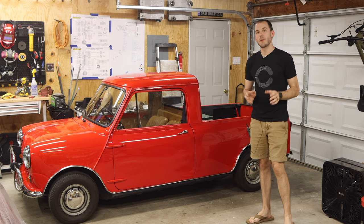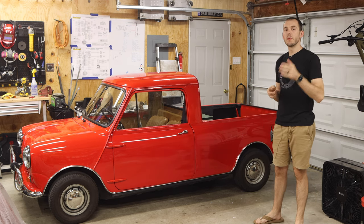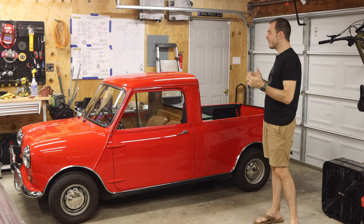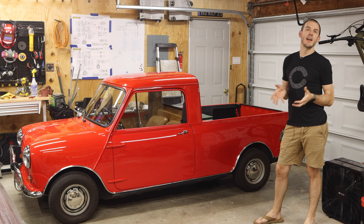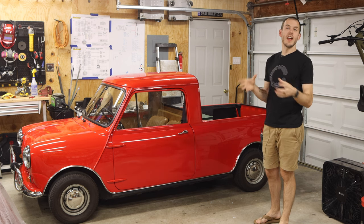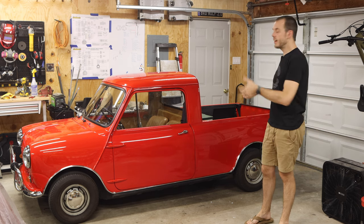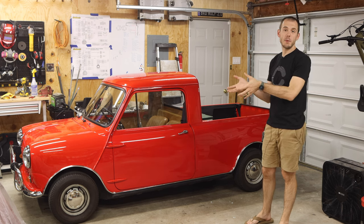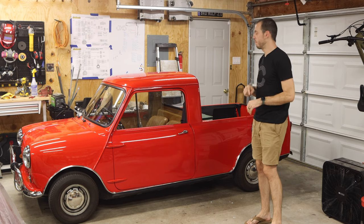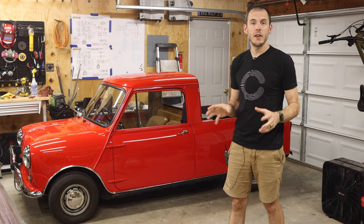As I said, on today's episode we are going to be doing some regular maintenance on this beautiful red Classic Mini Pickup. Many of you will probably remember this car — it got a Super 998 that I built at my old shop and has still been running and chugging away. That Super 998, for those of you who don't know, is a 998 with pocketed block clearances and a 1275 head on it, to really pull out all of the extra performance you can out of a 998. It has been running beautifully with regular maintenance. If you haven't seen that series, I would strongly recommend you go check it out — it'll be popping up in the corner somewhere.